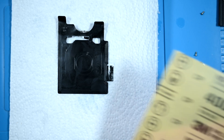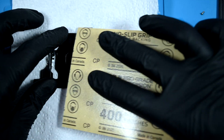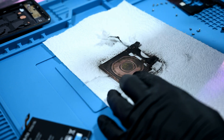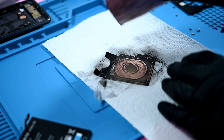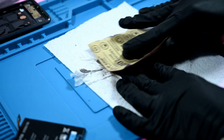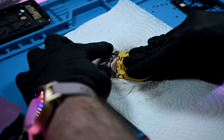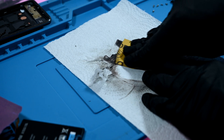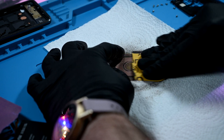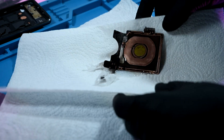This black plastic coating is incredibly annoying. I really wanted to show the gorgeous copper windings of the charging coil, and I've tried multiple solutions like razorblading it open, soaking it in acetone, and other solvents, but nothing worked. That's when I got truly dedicated and visited the local hardware store for some fine grit sandpaper. After a bit of testing, I found that 400 grit does great at shearing off the top layer of black plastic and exposing the copper coil. However, it is still rough enough that it leaves gouges and grooves in that beautiful metal. I'll work my way up from 1000 grit to 2500 grit to smooth and polish the copper with an even shine. After a lot of sanding, I'll clean up this black powder with some alcohol and a paper towel.